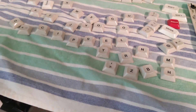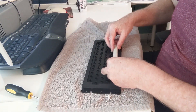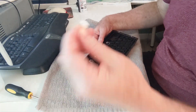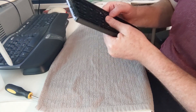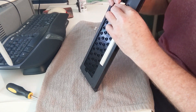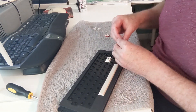At this point we've got all the pieces together — that's the white tray of screws that I later dumped on the floor. There's the nice alcohol-cleaned plastic, and I also rubbed NAPTHA and alcohol on the metal piece. There's really only one way these parts can go on, so it works out well. There's a little tab on the keys, and you can see it inside when you put the keys on — make sure you put the keys on right side up. The tab is nice because keys like X or O that could go forward or backwards become more obvious, since they all go the same direction.